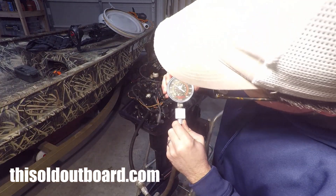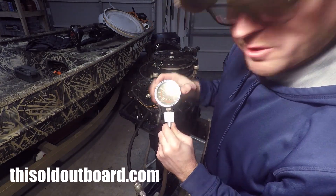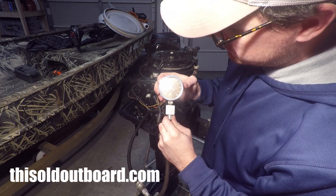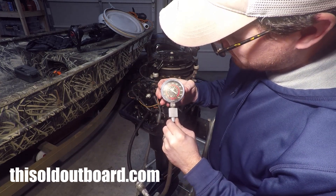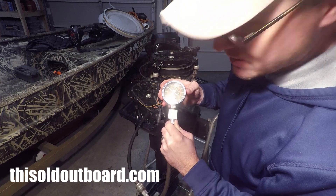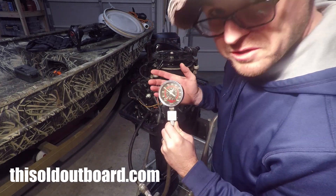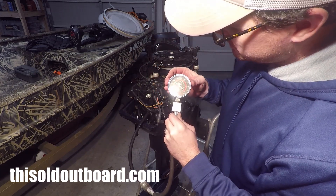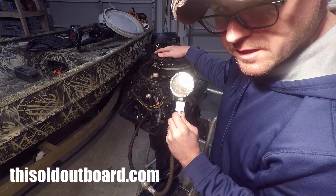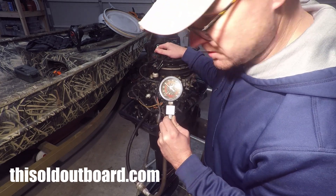Let me back this one off a little bit — got that in there. This one looks to be right at 87.5 PSI, so they're really close in compression, which is excellent. That's probably the main reason it starts so easily. Since it's got low hours it might not be broken in yet, but this is how you test the compression on an old outboard motor — and these are good compression values.